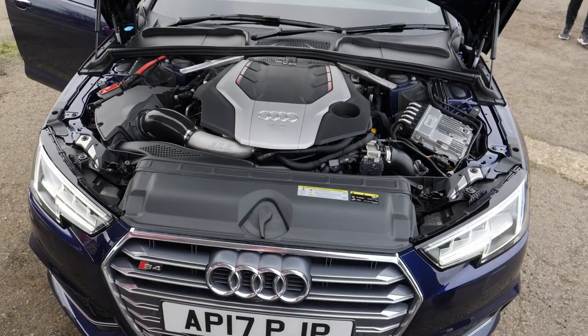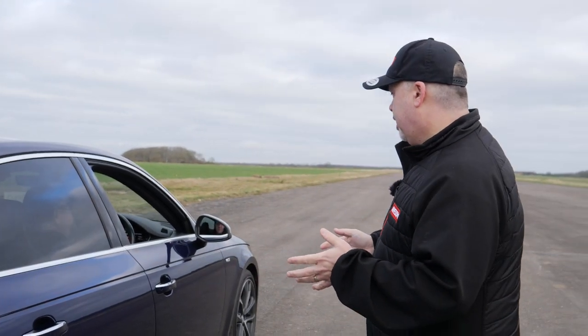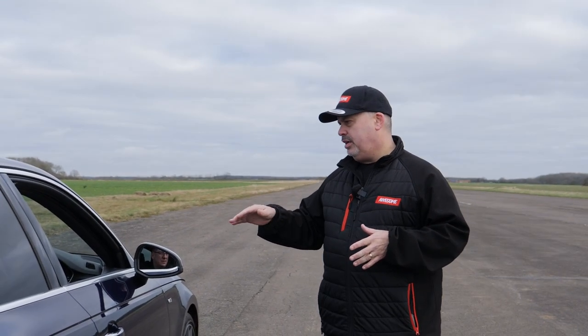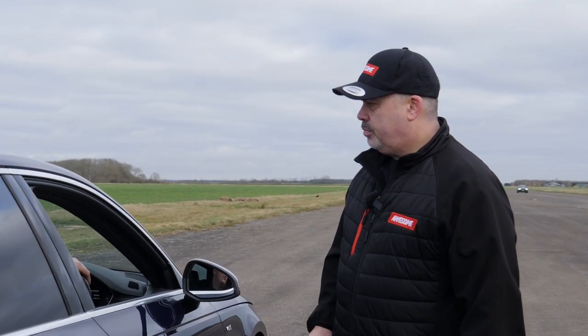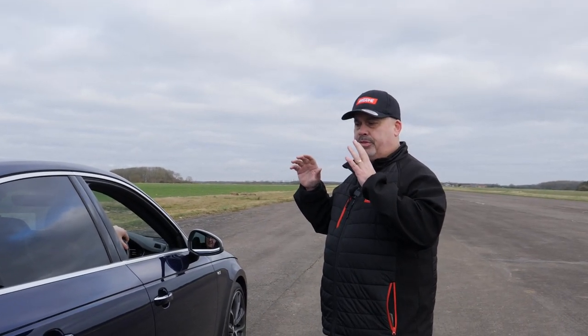I'm really intrigued to see what the 034 does — first time we've been able to test it outside of the dyno. We've flashed the vehicle with the Stage 1 034 software, and we've also done the Stage 1 TCU flash. The TCU is a pretty basic flash and they give it away for free — it's just got some torque limits raised. The Stage 2 TCU tune is the full one, which will be chargeable. So when you get the ECU flash done, you get the TCU Stage 1 free of charge at the moment.